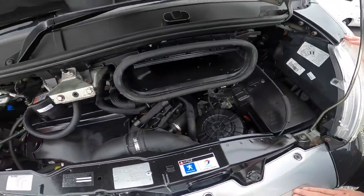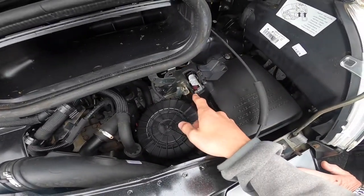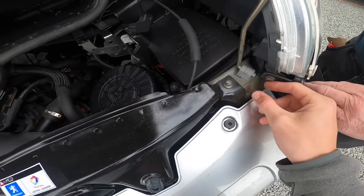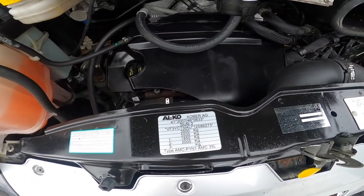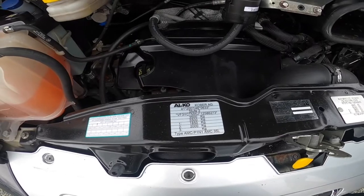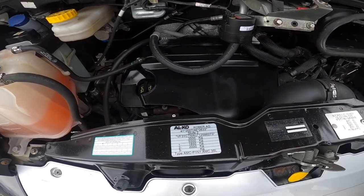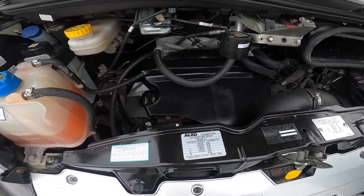For giving or receiving a jump start — as the battery is underneath the cab floor — you've got your positive terminal here and your negative terminal there, earthing off the side of the headlight bolt. You've got your weight plate showing three and a half ton gross vehicle weight. If you were to fit a tow bar, you can tow up to five and a half ton combined — so you can put a two ton trailer behind this vehicle.